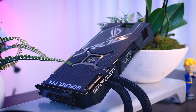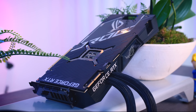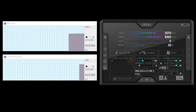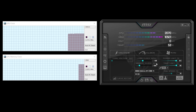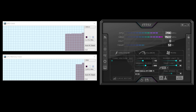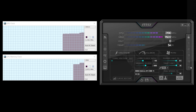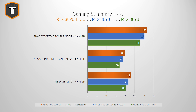If you're interested in a full teardown of this card, Tech Power Up has a really good one, so I'll leave a link in the description below. When it comes to overclocking, I usually don't spend much time on it because it's very sample-specific, but this card has overclockers in mind as it includes a little area on the PCB for voltage mods and readouts. With a power limit at 107%, I found it was game-stable at 2190 MHz but would start crashing at 2200 MHz. The memory went up to 1505 MHz without any issues, which is a pretty big increase. You're looking at another 5% to 6% more performance, and it didn't even impact power consumption that much.